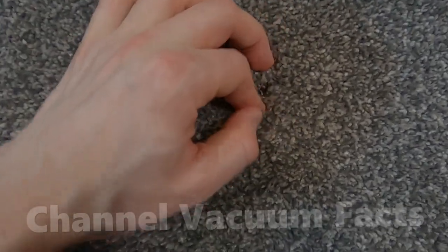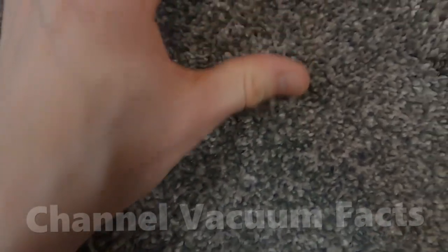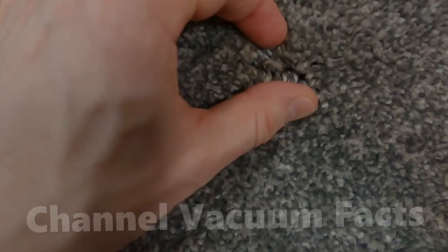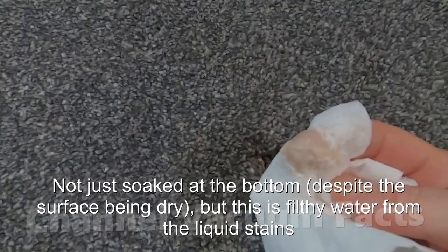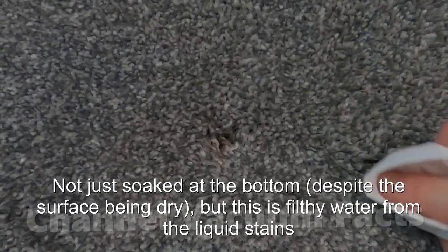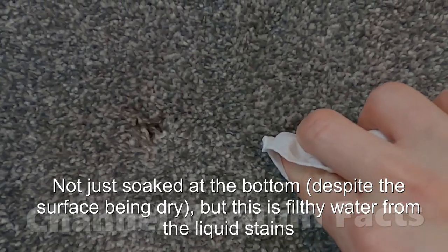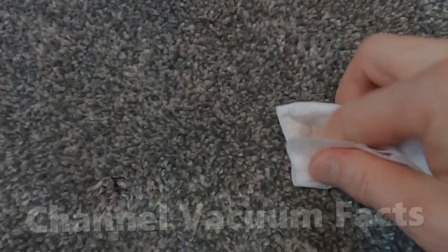The measurement they use to justify the claim that it cleans better than a dry vac is based on the dry particles that are left. This is misleading though because much of the dirt is dissolved into solution and is now stuck to the fibres and all at the base of the carpet. You can see here if you open up the fibres that some of the dirt has been washed to the bottom. If you stick a dry towel at the base, despite all the suction the machine has and how dry the surface is, it's soaking wet. It actually took days to dry at the base, and all that time the dirty water down there is a perfect breeding ground for mites, bacteria, mould and fungus. It actually started to smell a bit in the end when the pile was opened up. And the stains were still there, as were the odours.